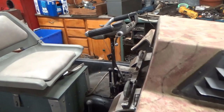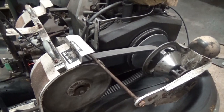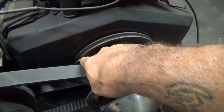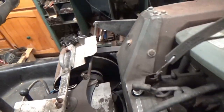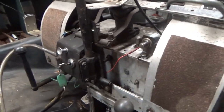Moving along, I was just showing you a bit of the drivetrain. It's got a snowmobile-type setup on both sides of the motor. There's a primary clutch bolted to where normally you would have the pull start — and it actually still has a pulley in there for a rope. Secondary clutch, just like a snowmobile, one on each side, because each one is feeding its own transmission.